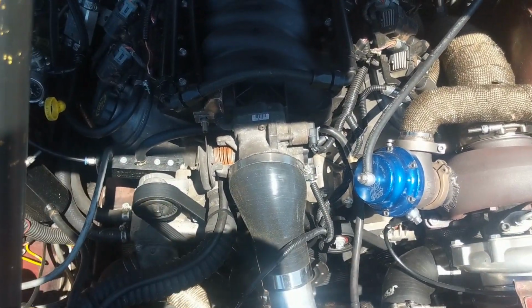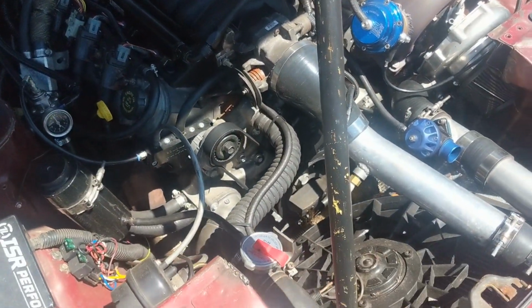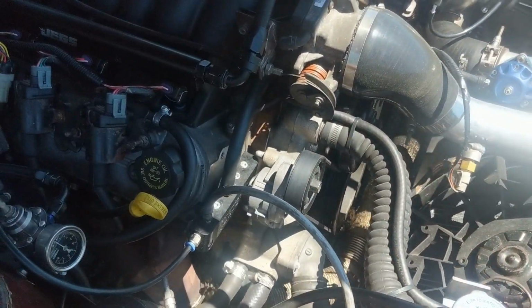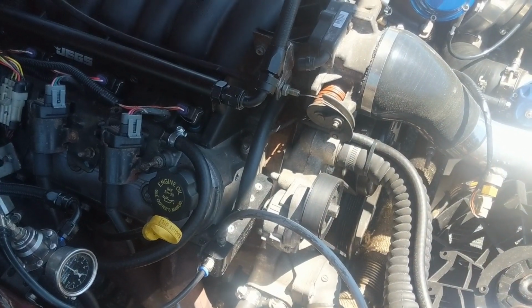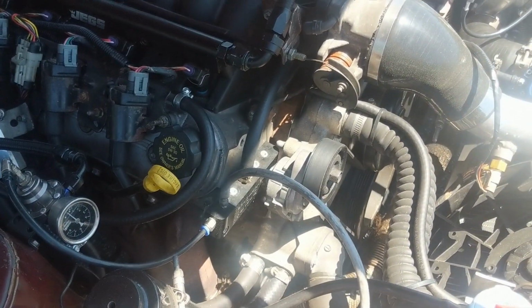Forgot to mention it has PAC 1218 valve springs, and they do pretty well. Summit says you shouldn't be revving the engine out too high with those springs in this cam, but I rev it to 6,900 RPM, no problem.